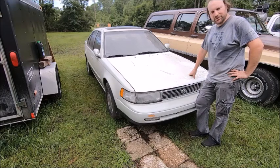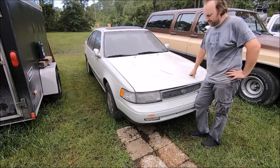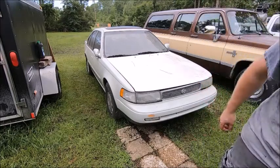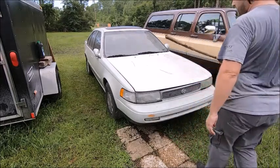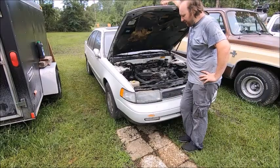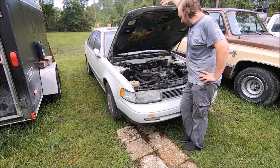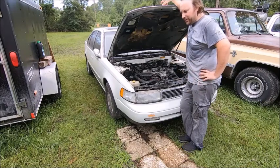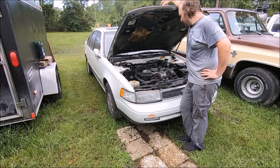It's in pretty good condition for the age and mileage. We're going to give you the quick tour and tell you what's wrong with it and what we're going to be fixing. It's hydro-locked — when the previous owner went to start it up it was locked up solid, so we pulled a couple plugs and it just spat water like a fountain. Basically we're going to be doing both head gaskets.